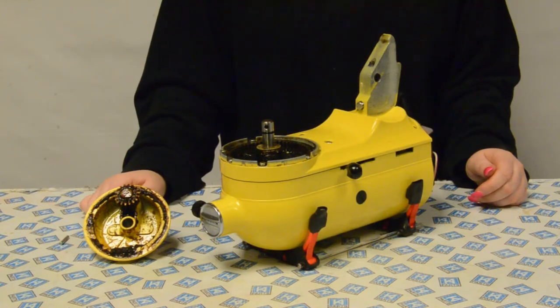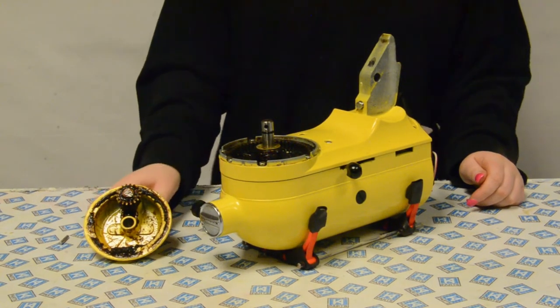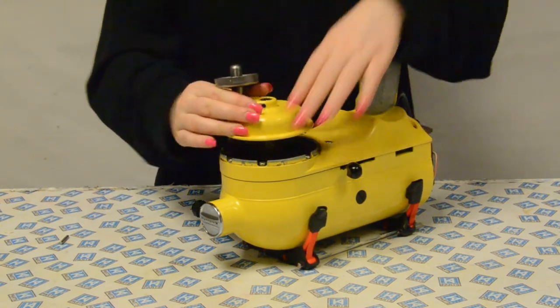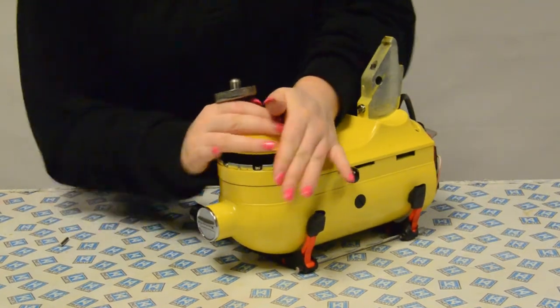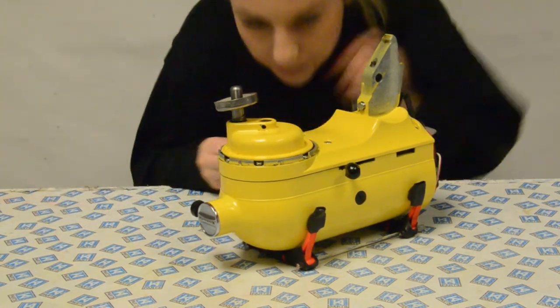Now all the screws are in, you're going to put the planetary back on. To do this, you'll need to line up the holes first, as this will make it easier to slide on. Then you'll get a drift punch and put it through the hole of the planetary to make sure it is lined up with the shaft. Take the groove pin and knock it back in using the drift punch and a hammer. The pin will go all the way through so that it is flush.